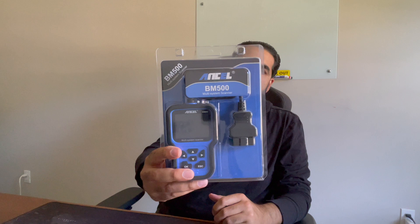What I have today is a tool provided by the manufacturer Ancel. It is the BM500. This is used for a couple of things: you can read fault codes, read any PCM adaptation issues, and if your car has a rear electronic handbrake or parking brake, you can put it in service mode or take it out. Primarily, this is used for BMW battery registrations.